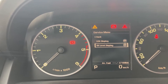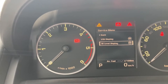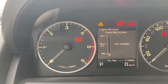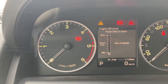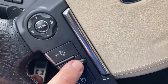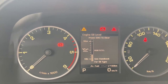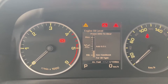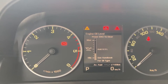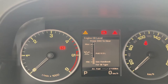With the engine stopped, we need to check the oil level again. This 3-liter engine has no traditional dipstick — you can only check through the car's computer. Go to Settings, scroll down to Service Menu, and check Oil Level Display. Right now it shows near the top even though we only added 5.3 liters — that's because the oil filter element wasn't filled yet when we checked yesterday. After starting the engine, the level drops. Checking now via the computer, it's showing not available — you need to wait at least 10 minutes after shutting down for an accurate reading. However, you can hit the cruise control cancel button twice within 2 seconds to get an immediate reading. The level did go down and it's telling us we need to add about half a liter — normal, since the oil filter housing is now full of oil.